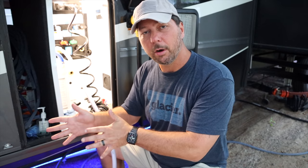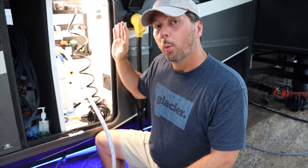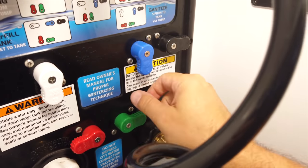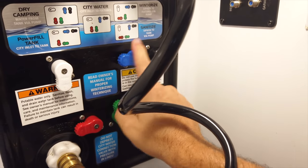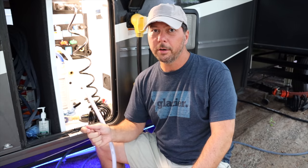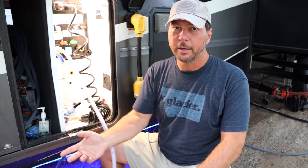We just got three cups of bleach into our 150-gallon tank. Now I'm switching it over to winterize mode, which siphons to the lines. We'll put bleach in there and see how that goes. Winterize mode: boom boom boom. Now Tara is going to go inside and turn on the cold water on a line until she smells bleach, and then turn on the hot water on a line until she smells bleach. We're going to coordinate over the phone.